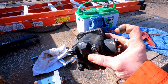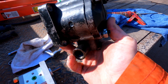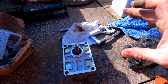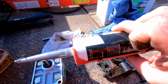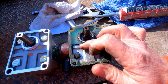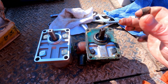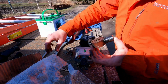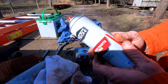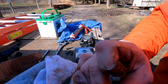When that pump goes on there, this port is on the back side so you can't really get to it. Luckily there's a banjo fitting that goes on this one, so this will come off with the housing. I'm going to put this over here, make sure the o-rings are all good. I got some of that five-minute instant gasket maker, so we'll use that on here because it looks like this gasket seals right on this lip. This straw applicator — you lose them after about 30 seconds. Anyway, I'll get a whole minute of this.